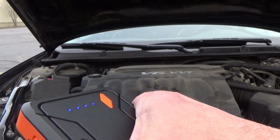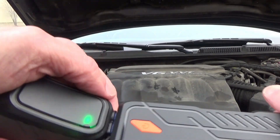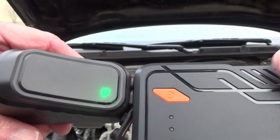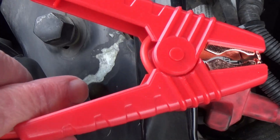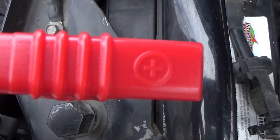To use it, you turn it on with the button on the side — there are the four power lights. Then you fully insert the jumper cables into the socket, all the way. It's flashing green, which means it's properly connected to the jump starter. Then you connect each of these cables to the corresponding terminal on the battery. The red cable is for the positive terminal, so it goes to the positive terminal on the battery, which has a plus on it.